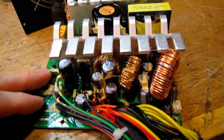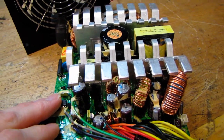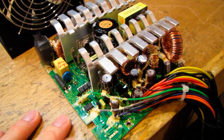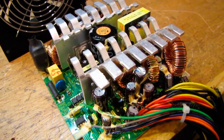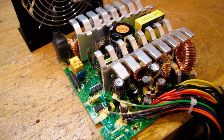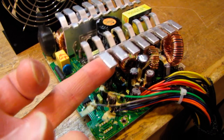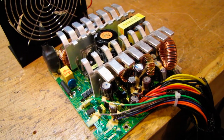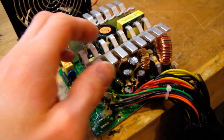Where they messed up was a circuit that runs the fan at low speed to keep it quiet, then is supposed to speed the fan up as it heats up. That circuit failed — the fan either came to a stop or didn't speed up enough — and the power supply actually overheated and burned up after about four months. He sent it back to SeaSonic to have it fixed, and they sent him back a different one that was dead out of the box. I'm really disappointed with SeaSonic for that. It wasn't just this one either — I have the Corsair-branded version in my computer upstairs, a 520 watt rated unit with the same board in it. Mine did the same thing — burned up after two months. I've gotten a replacement since then, same model, and I'm going to be modifying it with a better fan and hooking the fan directly to the motherboard to let that control the cooling.